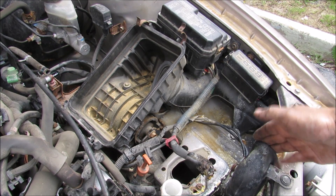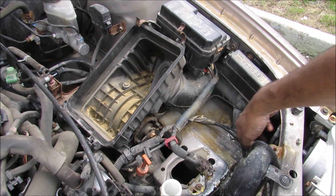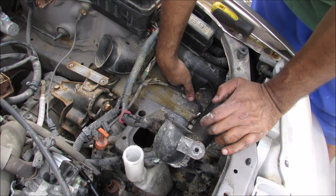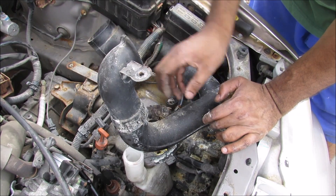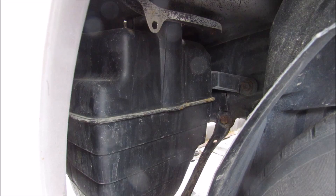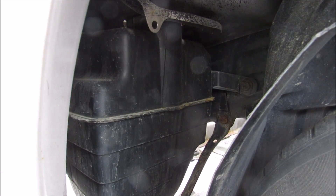You can see this here is where air is drawn into the system. It goes down through this duct and then into the air filter box. I'm going to pull out this box. Now I'm going to remove this intake hose. There's actually a passage here that goes to a tank down in there. And here's a closer look at that intake box behind the fender liner.